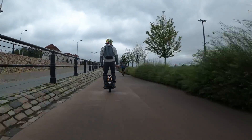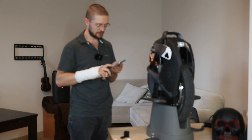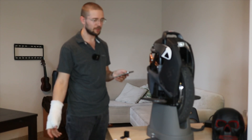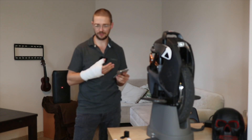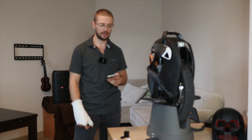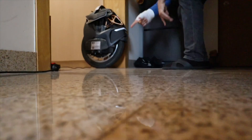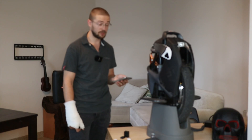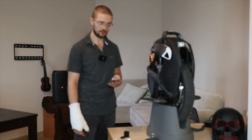This wheel beeps at you all the time. For example when you connect to EUC World it beeps excessively for no obvious reason. If the wheel is charging and you stay connected in EUC World, it will randomly beep at you constantly. Just disconnect from the wheel in EUC World when it's charging and that should stop.